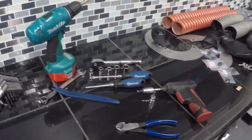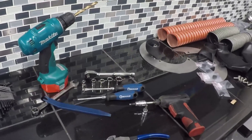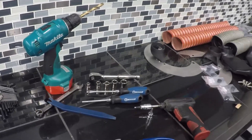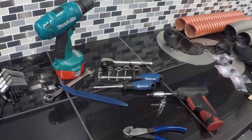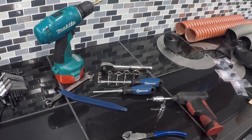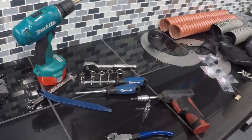What you're going to need to install this kit: a drill with a three-eighths inch drill bit, an 8mm, 10mm, 12mm, 14mm, and 17mm socket, a ratchet, a set of screwdrivers, a pair of side cuts, a two-and-a-half millimeter allen wrench, and a four and five millimeter hex socket.